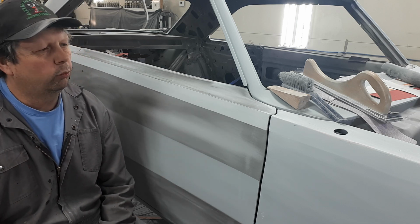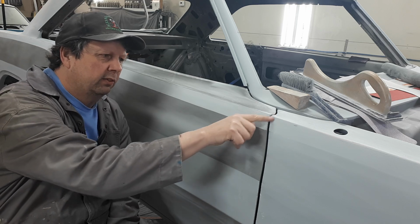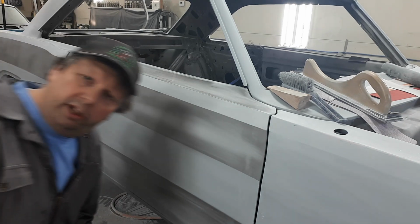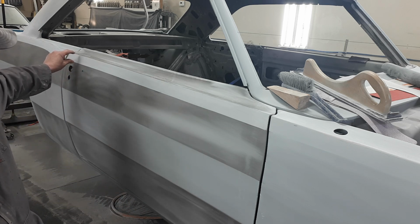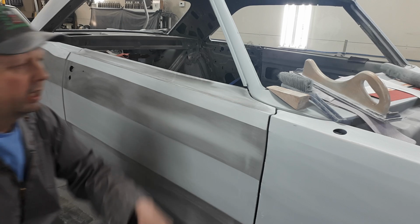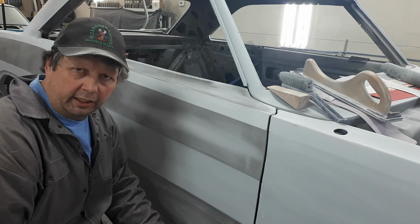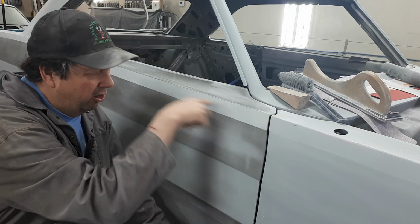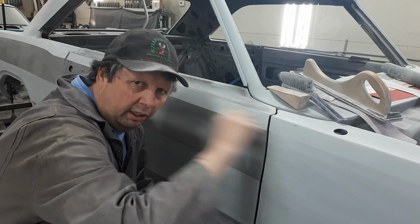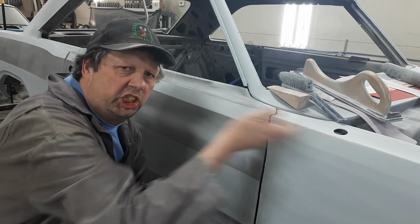Anyways, if you watched any of the previous videos on this, you'll remember that not very long ago, I had to pick this fender up in this area, because the fender was down. I don't know if you can really make it out, but you can kind of see in this door, and I measured it, I don't know how it happened, I didn't do it, but the gap here to here is a little taller here. This body line is where it needs to be, but the top of the door seems to ramp up, and on the other side it doesn't. So that's where our discrepancy comes from in here, and you're not dropping that down. So what I did, if you didn't see, is I made a big cut in the fender, I spread it, I put in a piece of steel, welded it back together, ground it, and now this is where we're at.